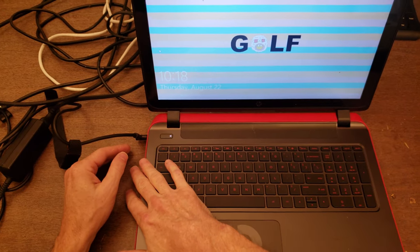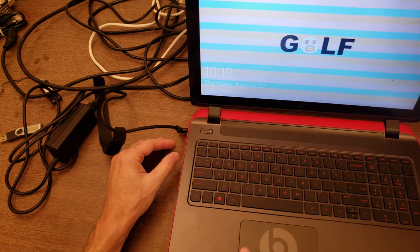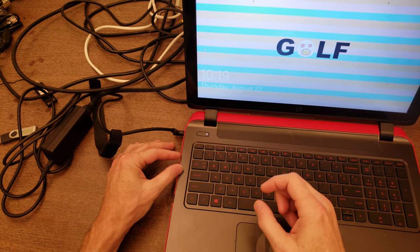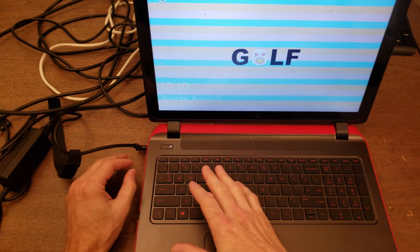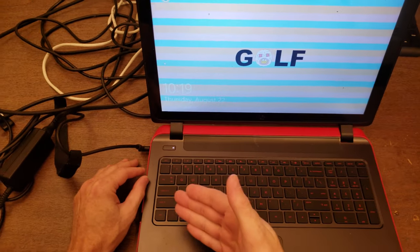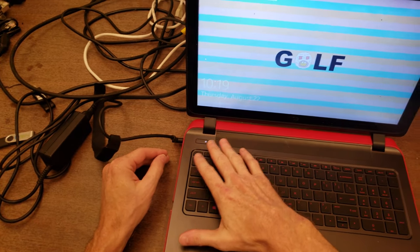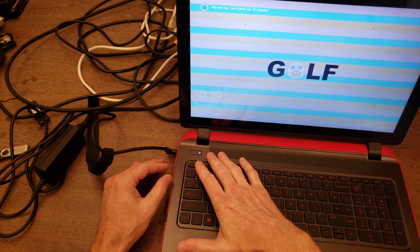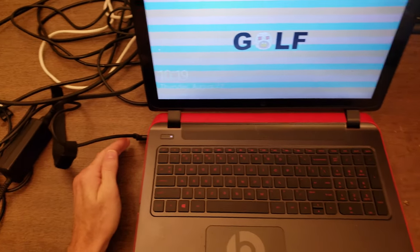it is room temperature. So in that other laptop that I came across, what had happened is the heat sink that is meant to carry the heat away from the processor out to where the fan can blow it out of the laptop, the heat just stopped about halfway along that heat pipe. So the fan in here is really, really trying to get the heat out, but the air coming out is room temperature. So I'm pretty sure it's the exact same problem.